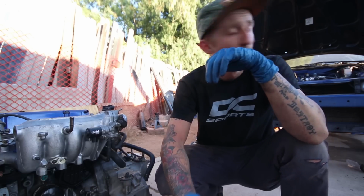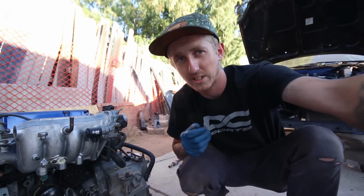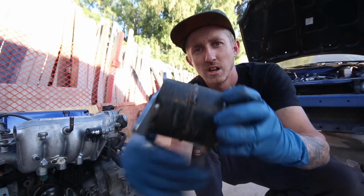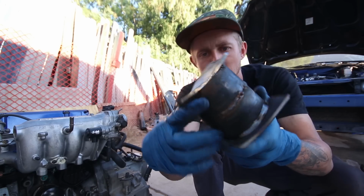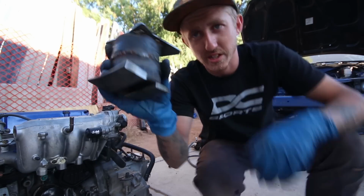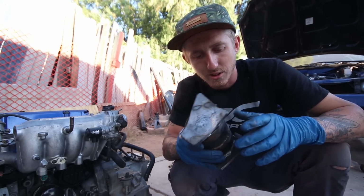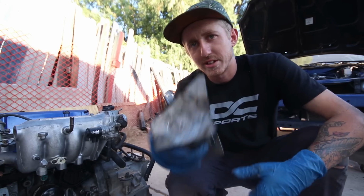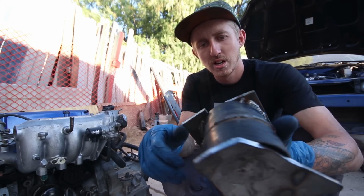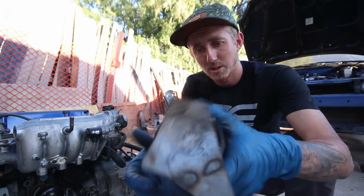So yeah, we got the trailing arm bushings pressed in. I had to make my own little tool. Let me go grab that, let me show you guys. Alright, so this is what I used to get the trailing arm bushings in. I took both of the old bushings out of each arm and I just welded them together. And then I welded on some steel on the bottom so that I could have a flat plane, because I tried doing it with just the cup, because it's the same size, bushing to bushing, but it just kept slipping off the edges and it was starting to dig into the ring on the new bushings. And then I welded this plate on top so I had a flat surface to push on. But basically it's a cylinder with space to fit over the sleeve, and you can tell I got pretty beat up as it's all indented, but still works.